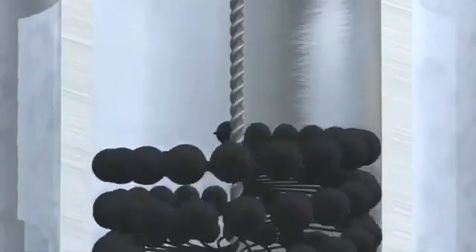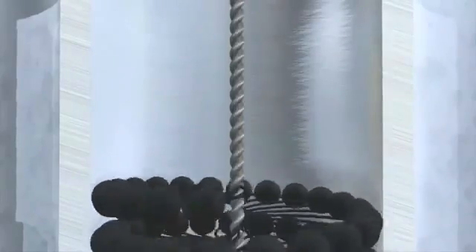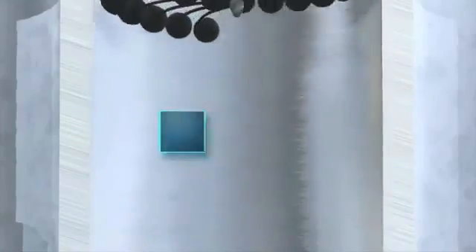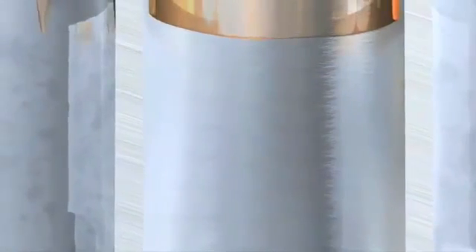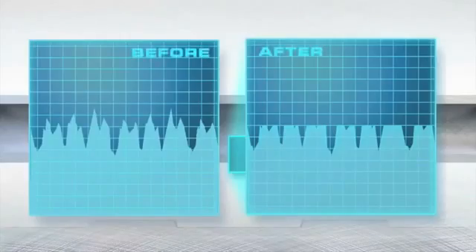The surface of a typical engine cylinder has sharp ridges with torn and folded metal. Within seconds of using the Flex Hone tool on a new or rebuilt motor, it will deglaze the cylinder and leave its surface with 20-40% values for oil retention, allowing the piston rings to seat immediately. The cross-hatched surface gives the cylinder proper lubrication distribution, assuring a long, lasting surface.